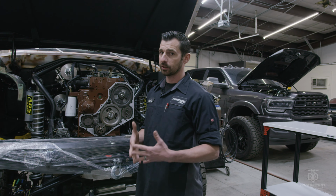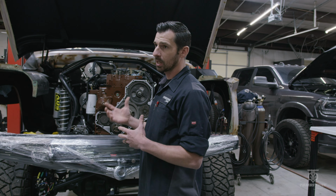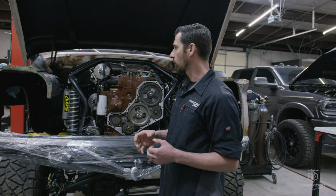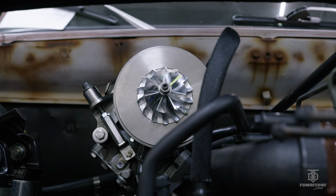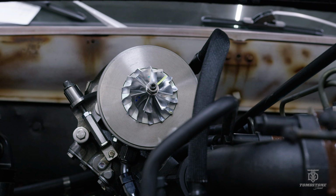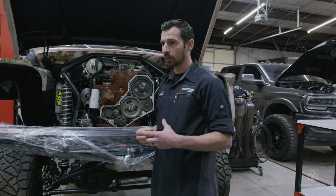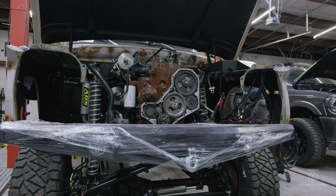We ended up modifying that exhaust housing to get it within really close tolerance, but still accepting a heat blanket, making everything fit really tight, but into a perfect fit. We ended up changing the wastegate and going to a stainless diesel wastegate, the spring gate, but we did end up modifying it to fit this. So we measure the spring tension to make sure that we're still going to gauge at our appropriate boost pressure, so everything still works within the same thing.